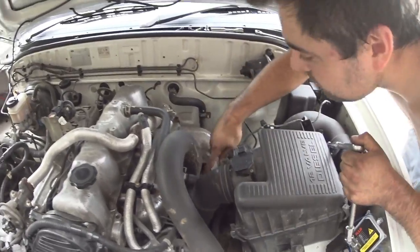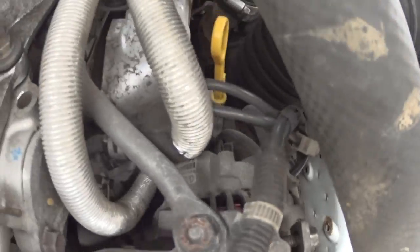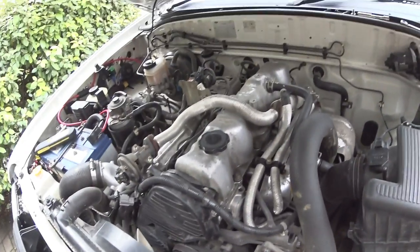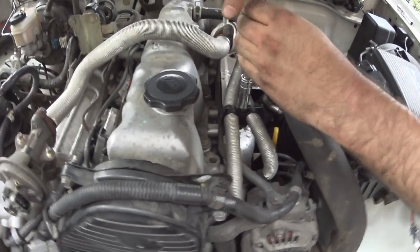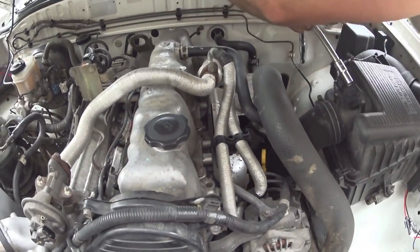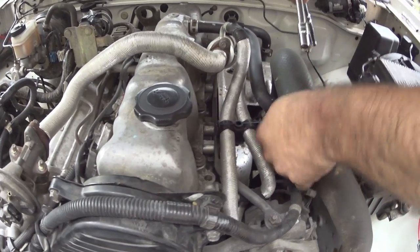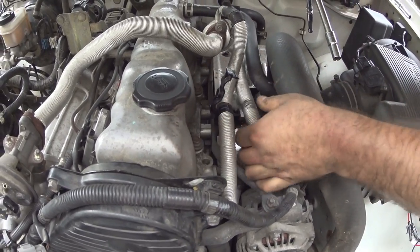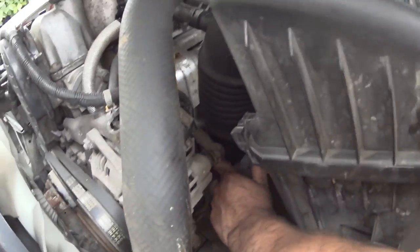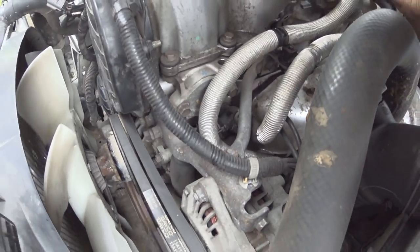Because Nathaniel's is a two-wheel drive, there's no coolant line for the turbo, so that's been capped off right there - so the triple-T is actually just a double. We'll take this clamp off the coolant lines - it's got a big self-tapper for it. Then it unclips from the side and we're basically taking it from the thermostat housing and linking it straight to the T-piece on the head, getting rid of the EGR loop.